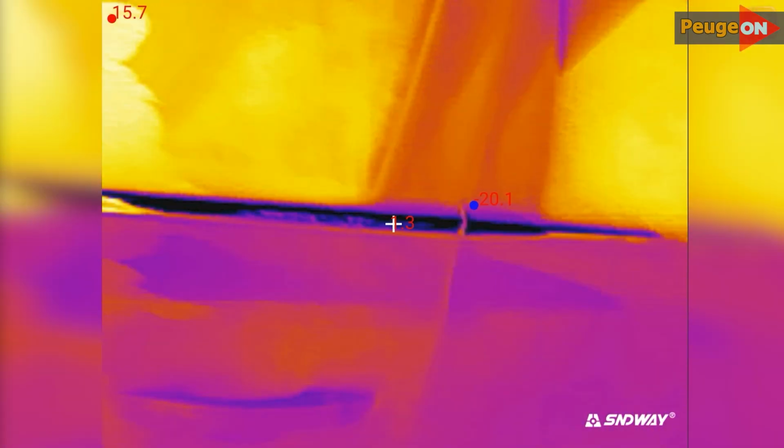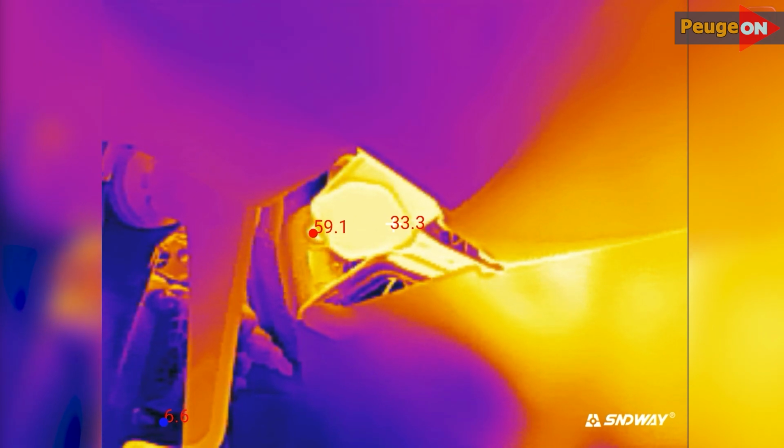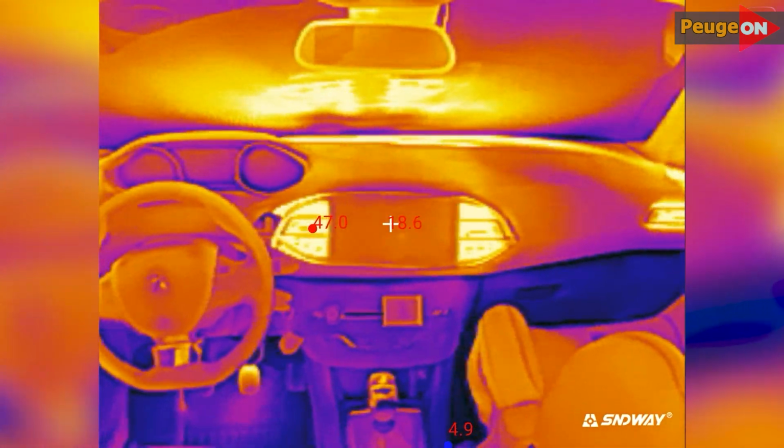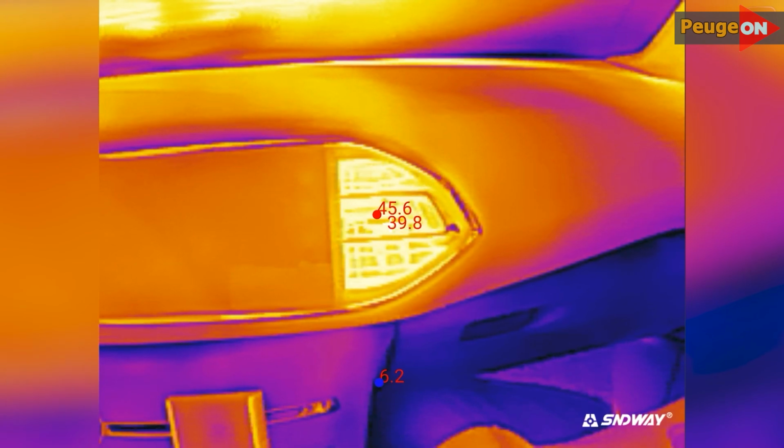When the heater gets clogged, it usually heats less effectively, particularly on the passenger side. In other words, on the left it blows hot, while on the right for the passenger, it blows warm. Before flushing the cooling system, the difference in similar air vents, left and right, was on average 3, 4, sometimes 5 degrees. That is, the process of clogging and contamination is evident, and after flushing the system, the difference was 0 degrees, or 1 degree. And the worst case is 4 degrees. This is at the driver's and passenger's feet.